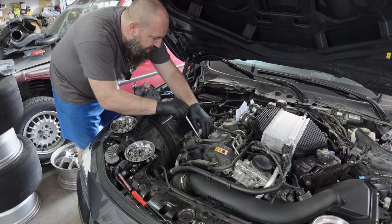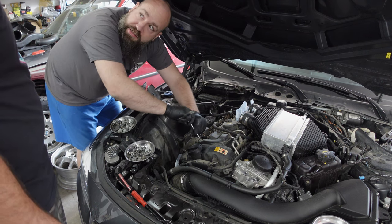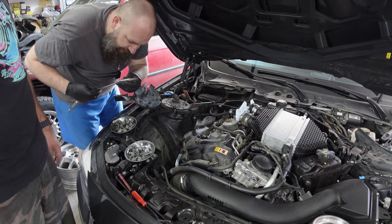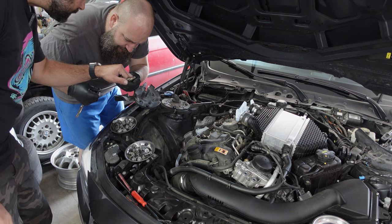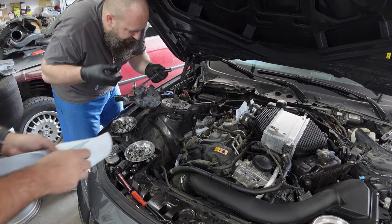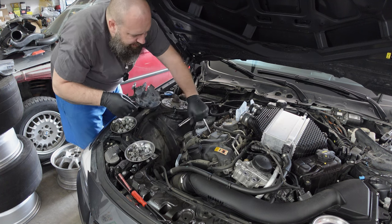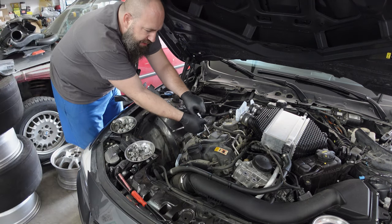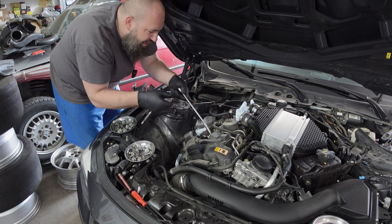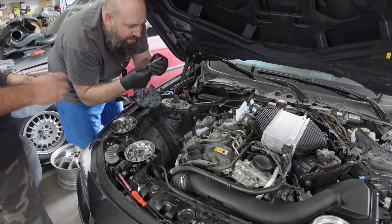Time to pull the plugs — laying them out in a row. One looks like it was arcing over, and there's oil on it. It's a factory plug — Bosch — which is a very weird looking plug and it's the wrong plug too. NGK seems to run quite a bit better in these. Bosch is stock, but if they left it at the stock gap and never changed them... actually, I have a feeling they had aftermarket plugs in here and then threw the stock plugs back in. Cylinder 2 also has oil on top.